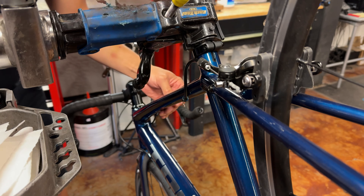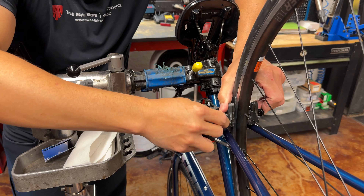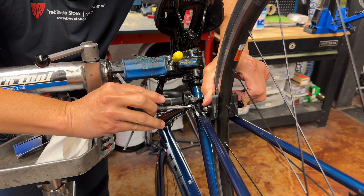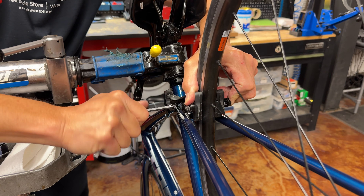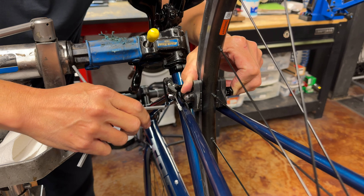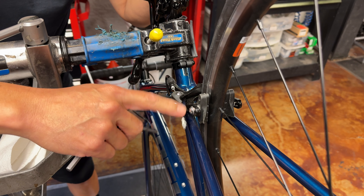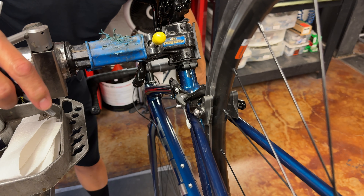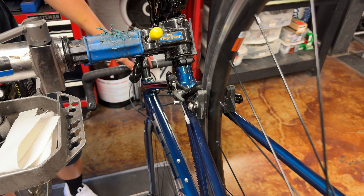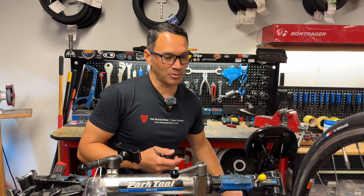I can replace all this now and reset my cable, and hopefully that works. You know what else hopefully works? Like, subscribe, bell notification icon — if you guys are getting some enjoyment. Tightening on your brake cable does not have to be extremely tight — you just have to deform the cable a little bit and that's completely effective. After you've replaced that, go ahead and check out your line and see how it feels. That's getting the friction out of the line — hopefully you now have a nice snappy feel at the lever.